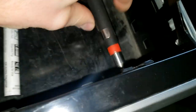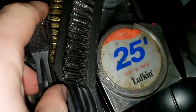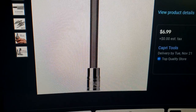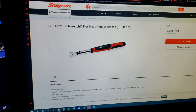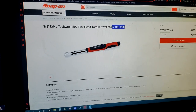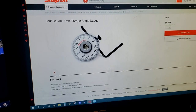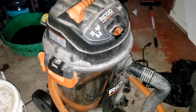You are going to need a tire paint pen - one of these, absolutely need one. I got these scrubbers from Harbor Freight - they were really cheap. You got plastic and copper ones. You're going to want a long T30 - that's going to come useful when you're doing the intake manifold plus several other parts. You are going to need a torque wrench. I actually needed two torque wrenches because the first one was for the mid torques and this one was for the smaller torques. These are capable of doing angle gauging so you wouldn't have to buy a separate one, but you do need the ability to do angle monitoring for your torque specs.